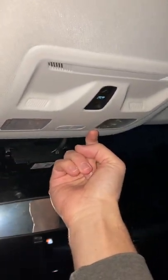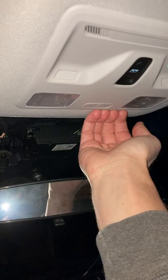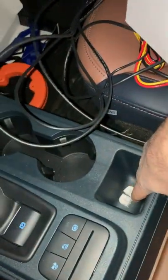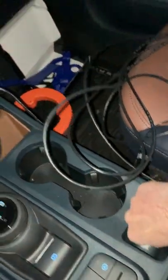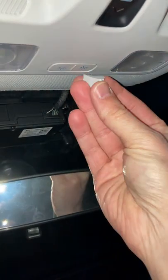What you've got going on is there are permanent clip hinges — one and two — behind here. If you pull down here, you're actually going to break those clips. They're fixed plastic clips, and I did that — I broke those clips.